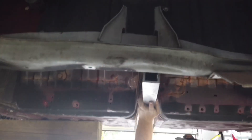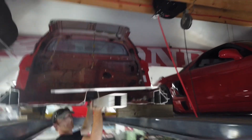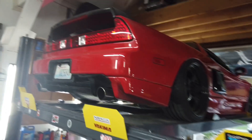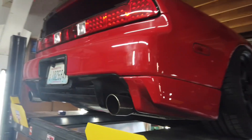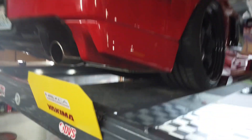Right now we're test fitting everything. So this tongue - I'm thinking we're going to mount it to this cradle, go across through this tunnel, and it'll stick out like that. Right now it's sticking out about 48 inches, so four feet long, which is longer than I think I'm going to need. First thing I need to do is take off this rear bumper, rear valance, and these little side rear valance pieces back here.